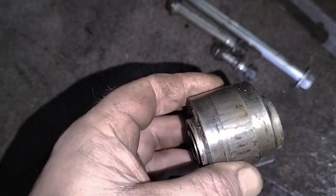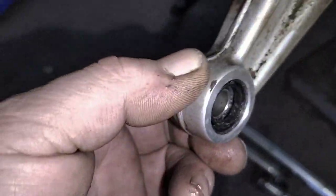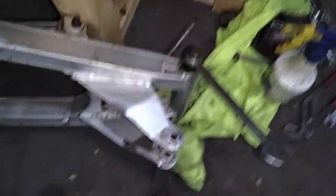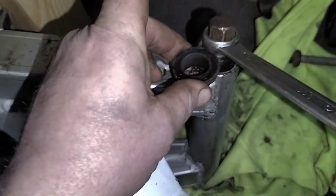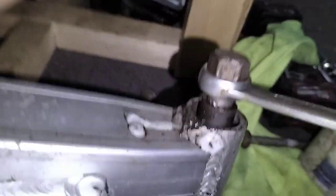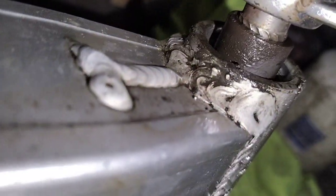I can't get any grease in there. There are needle bearings here — I've gotten that out. There's a little bit of rust on here so I'll be cleaning that off and re-greasing the whole thing. This bushing is nice and free, it's moving around, so I'm not worried about that. Here are your side caps and grease seals that go back on there — I'll be putting them back in, gluing them in. The swing arm has these side covers on; they go on the bushing. It's in there, but these bushings are a little bit seized up, which is why it was very creaky.